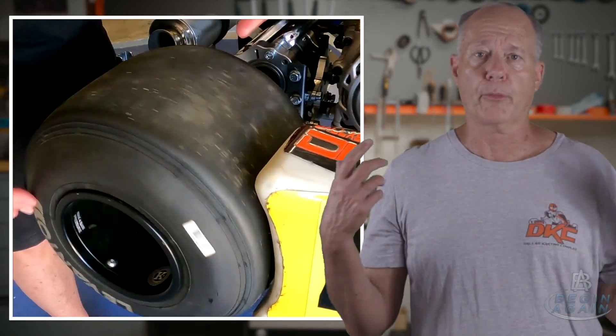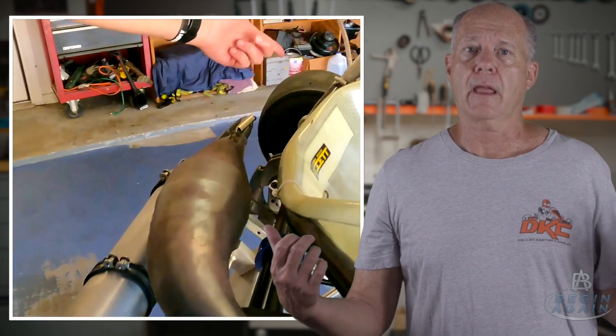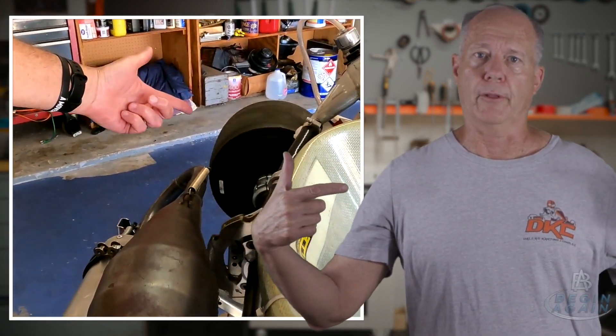Differentials are illegal on go-karts, because they want to keep go-karts simple. So what does a go-kart have? It has what we call a live axle - both rear tires are connected in a single aluminum tube that spins in a set of bearings. What happens is that regardless of whether you're in a right-hand corner or a left-hand corner, the outside tire is wanting to turn at the same speed as the inside tire, and that's where we start getting into trouble. We've got to trick the go-kart into thinking it's got a differential.